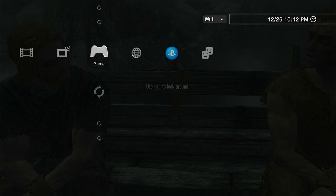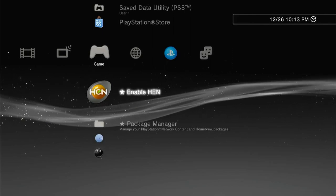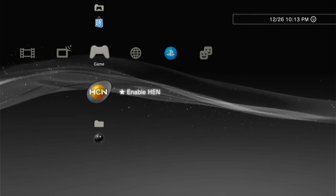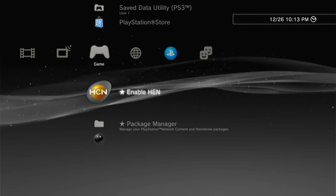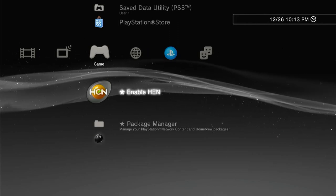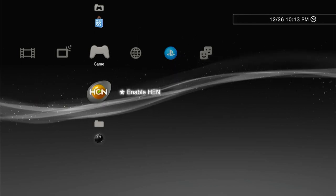We're gonna eject the game and insert it a few times, you know, make sure that the Blu-ray drive is functioning, not just a one-off chance it worked. So now we're back to the home screen. So I ejected the game and popped back in, and it pops back up, so that's great. And eject again, insert, it's reading, game pops up, great. Eject, insert. I do have to note that when I insert the game, it's very weak in accepting the disk into the drive. It keeps on popping up as I eject it and insert it again. So the Blu-ray drive is in need of a really good servicing.